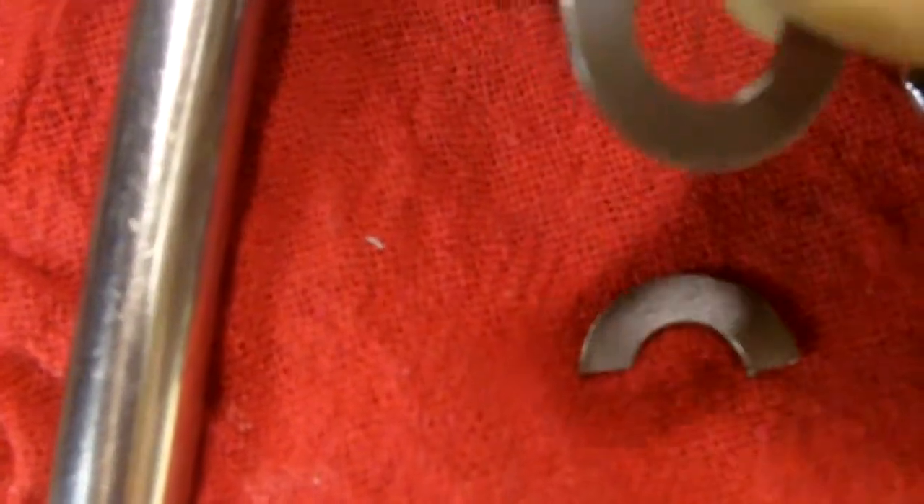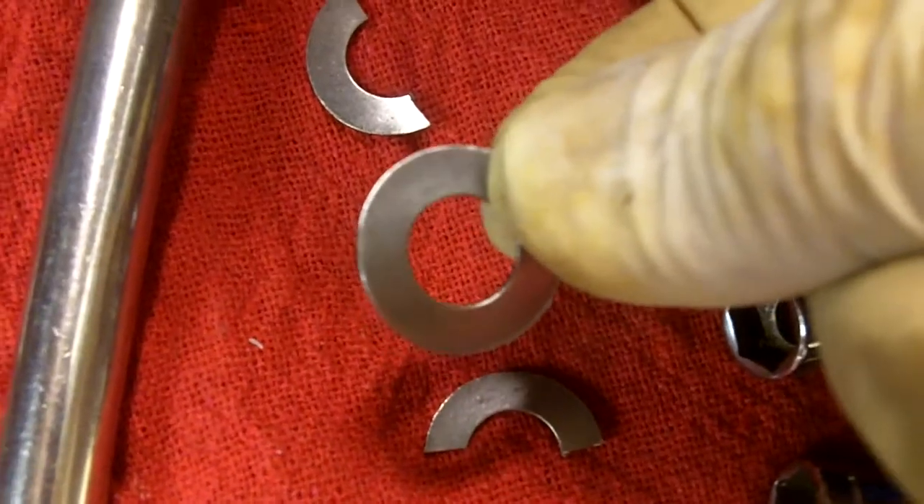What I do is I back off this — you've got your common 14mm nut. I'll use a 14mm universal 3/8 drive to get in there; a quarter inch works even better in some applications. You get up inside here and back the nut off just enough where you can slip the washer in place. I've taken a standard DIN 137 10mm wave washer.